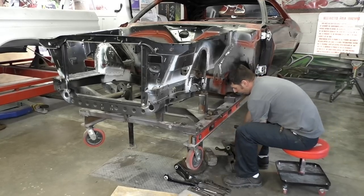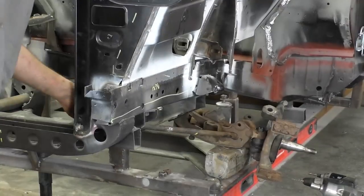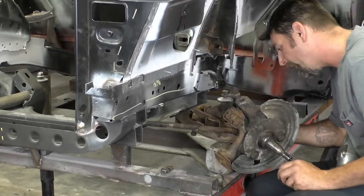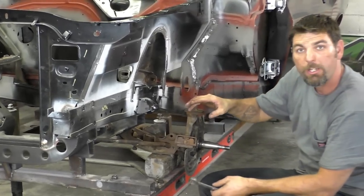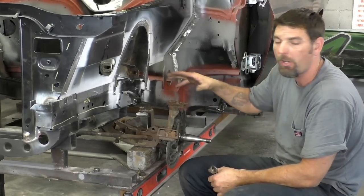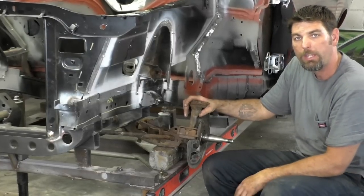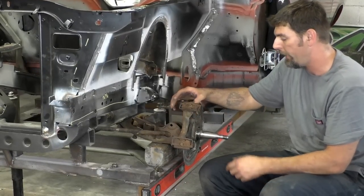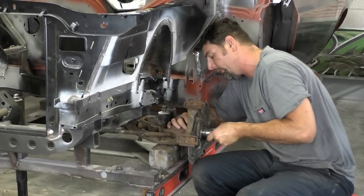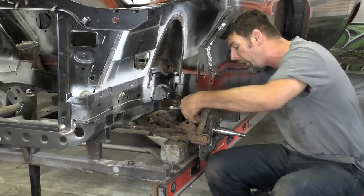Assembling the front end for what we're doing - we didn't really clean anything up, we don't want to scratch or nick anything. We put ball joints in this car because they were so worn out. The bushings are actually worn out too but we'll get to them down the road, same thing with the strut rod bushing in the front. I had to go get a bushing for the top joint because it was trying to spin - the bushing needs to be replaced - but we got new ball joints. So we got our lower control arm on. You don't want the ball joints loose - any movement is going to throw off the measuring tool - so let's snug this bottom up a little bit.